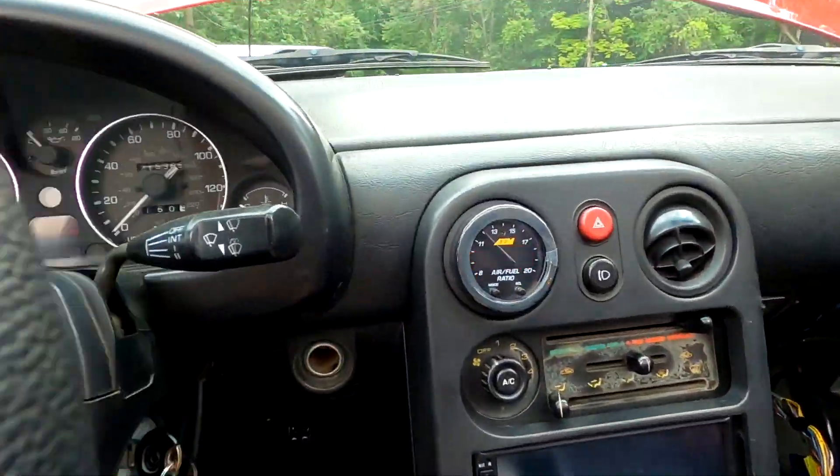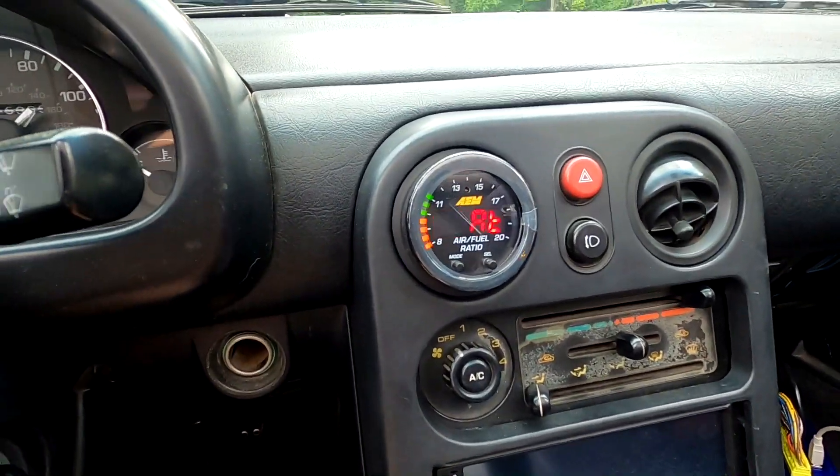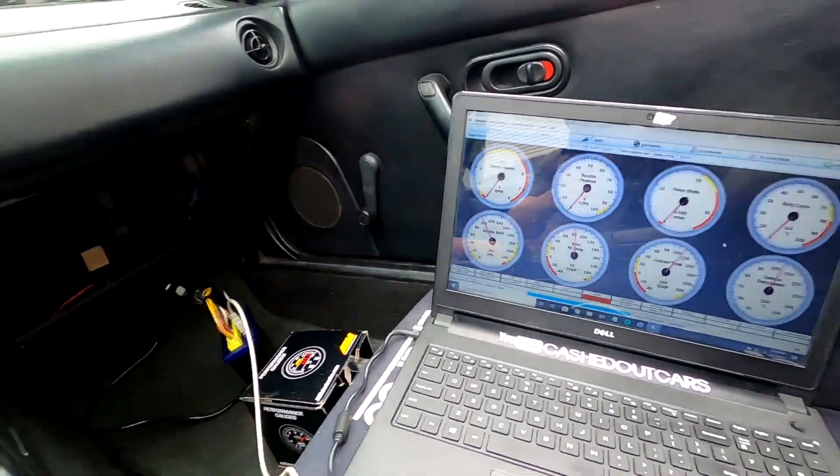It is the next day now. I figured out the problem — I'm just going to show you that the car starts and that the gauge does in fact work. What I had to do was revert my ECU to some older firmware with an older tune, which is actually what I should have done in my Speedy EFI installation video. So if you order from Speedy EFI, keep the firmware and the tune that they send on the ECU — it's guaranteed to work. If you update it, it might not. Now let's start this thing and I'll show you that the AFR gauge does work.